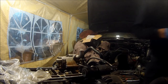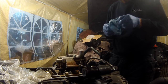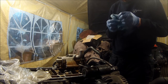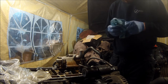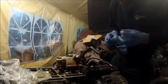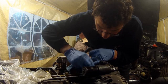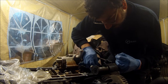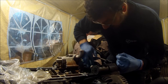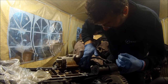I'm putting the shim back in. I did look around online and I couldn't see the exact reasoning for not putting the shims back in. I think the Vanos pump might have changed ever so slightly at a later date when they changed to the revised gears with a different tooth pattern. I can't see any harm in having it in there. It was there when I took it out, so it's going to stay in there. I haven't changed the Vanos gears, so I trust that BMW knew what they were doing when they built the engine - other than the rod bearings, obviously.